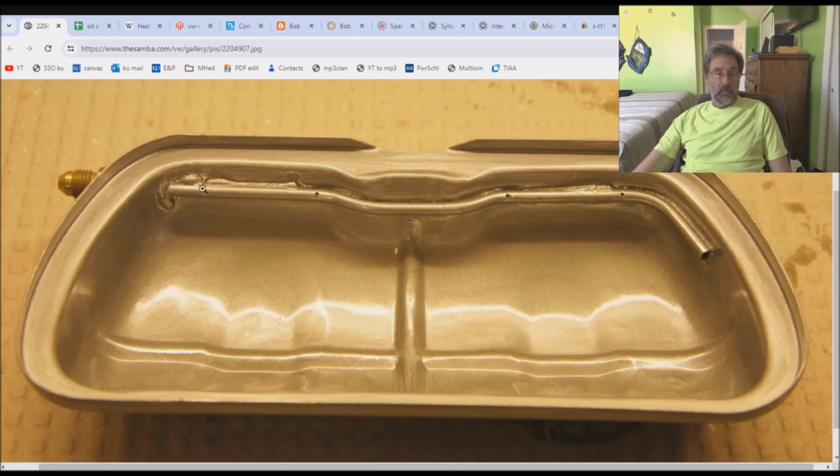We think about this. That particular hole right there, don't put these holes in. Those holes point at the backside of your exhaust port, and they're putting exhaust heat into your oil. You need to focus on this area right here. And like I said, this is a general purpose, just throw oil on the head type thing. And I personally feel as though it's not worth it.